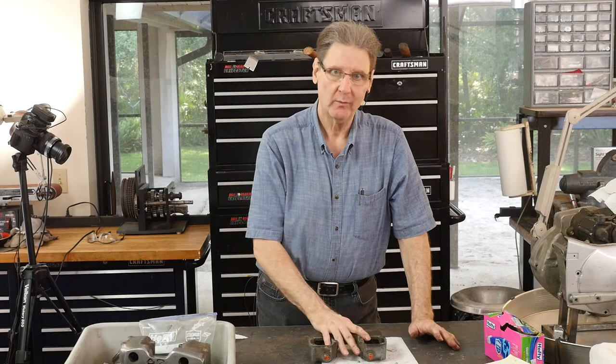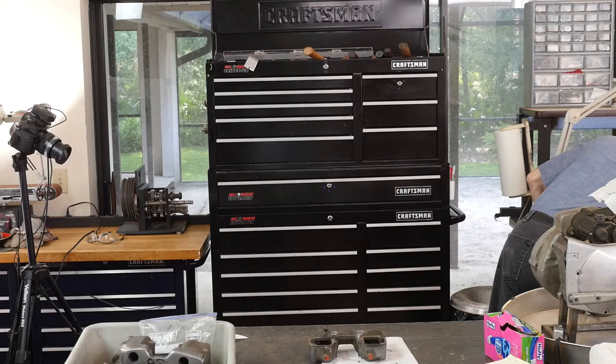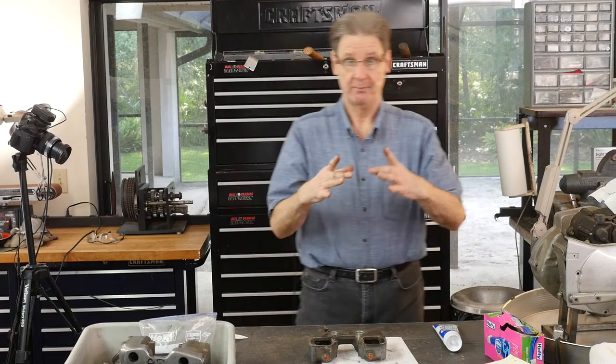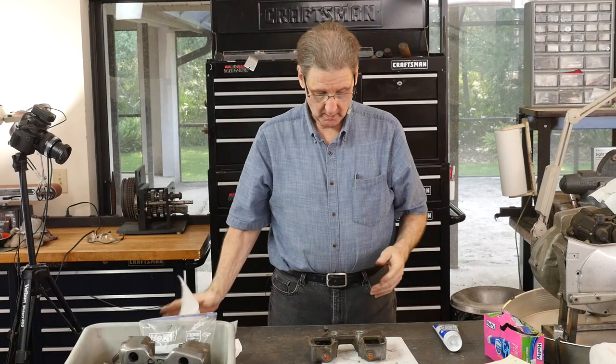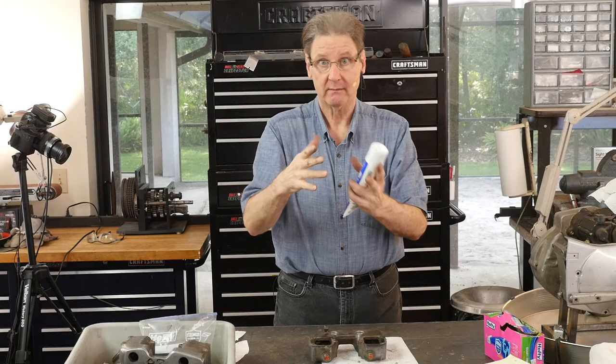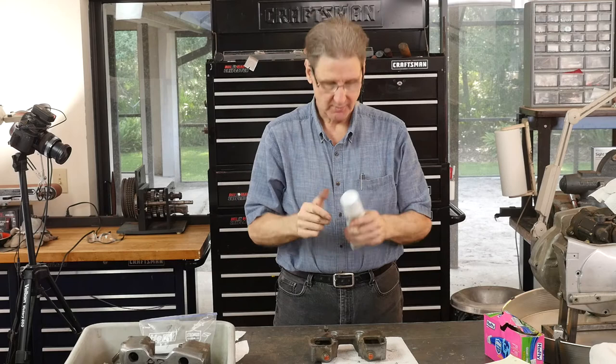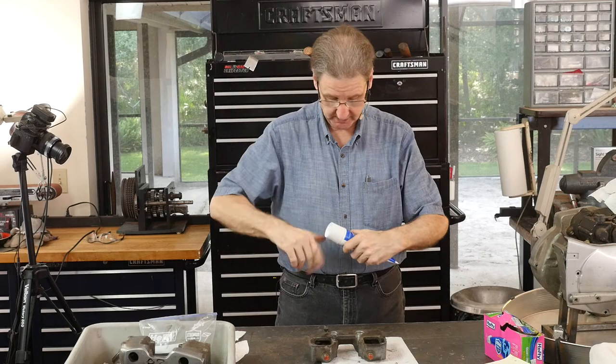Just put away wet — decades of the oil congealing and hardening. I used to use the pots of lithium grease. That's what I saw the engine builders doing in San Jose. The bike will run a long time even if you forget to put oil in it — on lithium grease, it doesn't have fiber in it so it won't pollute stuff. But all the crap in the shop falls into that bucket. Now with the tube it's never contaminated. So putting stuff together, we'll be using lithium grease — but the tube.